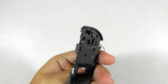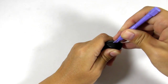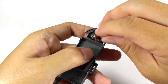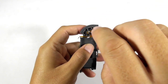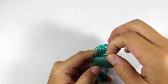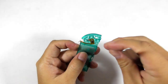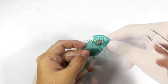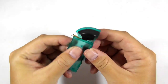Now we need to remove the ZR button. Do the same method as before: cover the button with your finger and use a plastic opener tool to pry the button out of the shell. Now remove both springs and remove the tiny button board using a Phillips screwdriver. Now take the replacement shell and do the same thing as we did previously — install the tiny button board, place the springs, and reinstall the ZR button. Then test the button to make sure you can feel the button click normally.